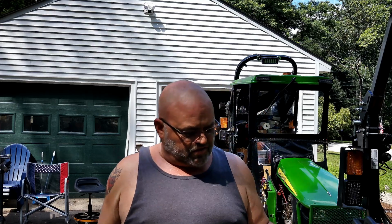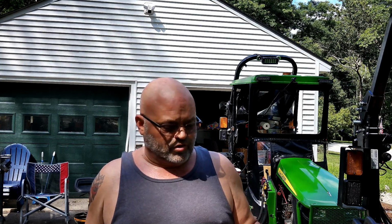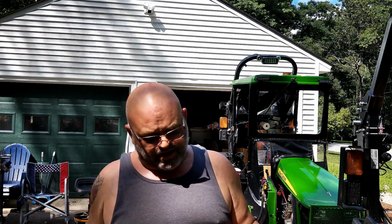Okay. So a couple of things. When fluid starts coming out of those little holes with the little Allen plugs, you're full. So stop pouring. So be cognizant of that. I've checked it with the dipstick, and I've added the plugs back in again, and it's fine.